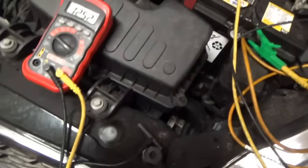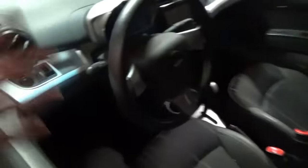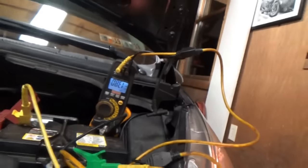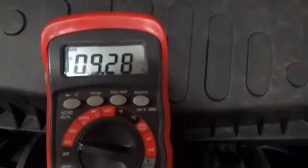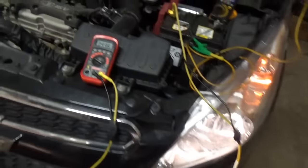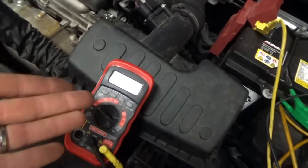Let's see what happens when we turn the headlights on — how fast the voltage will drop. This is my favorite draw test in terms of battery capacity. Headlights on — we have about 15 amps leaving the battery. Look at the voltage: 9.3. Headlights are getting dim. The car won't start. And this car has automatic headlights — when you exit, it leaves the lights on for like two minutes. That explains why the owner got stranded: he leaves it at the store, locks it, lights are on for a couple minutes, boom — battery is completely drained.